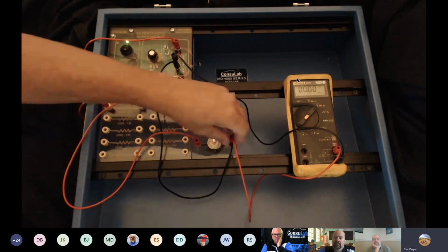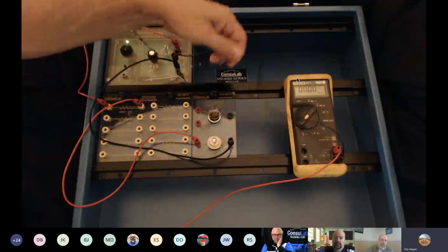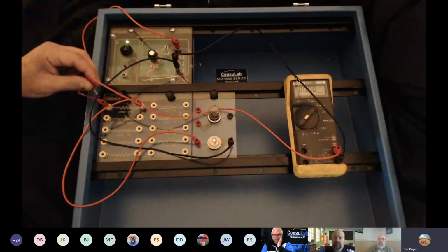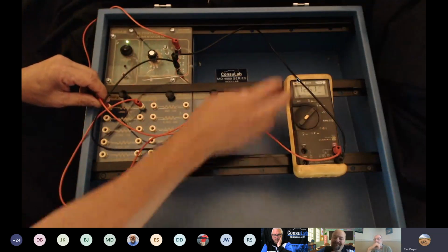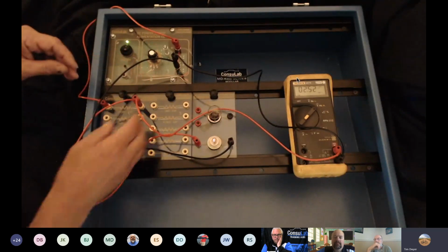And so we start talking about voltage drops. Jeff's big on a ground reference voltage, meaning we leave the meter stabbed at the battery post, grounded, and then I come down with my lead just like we did, and I measure it. It's 12.6 going in, it's 2.6 coming out, so we drop 10 volts there.